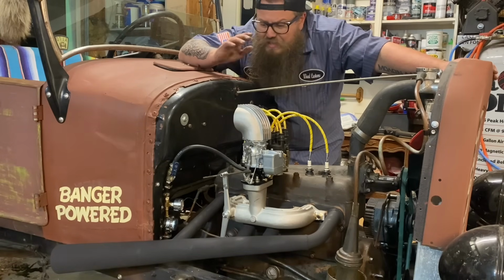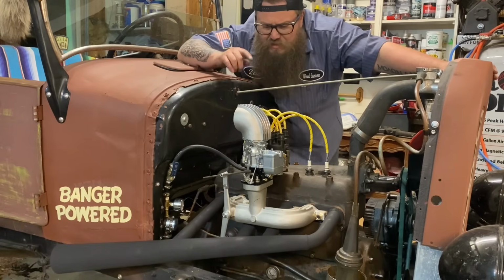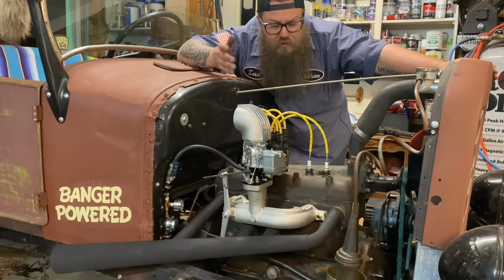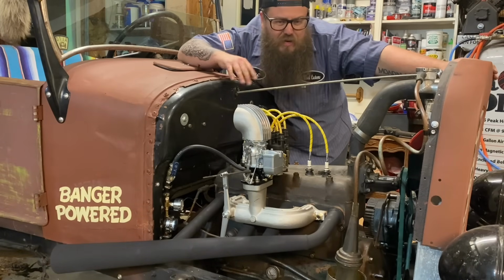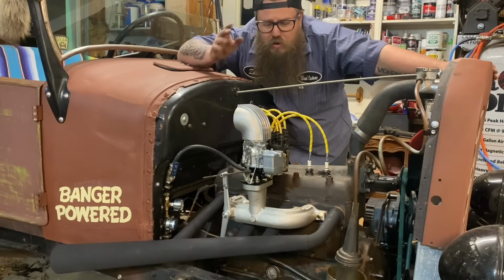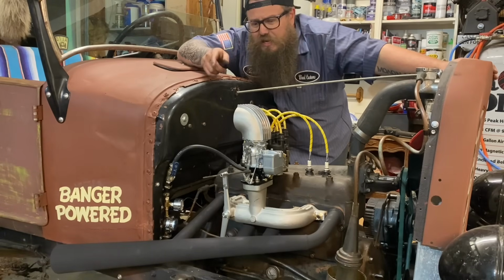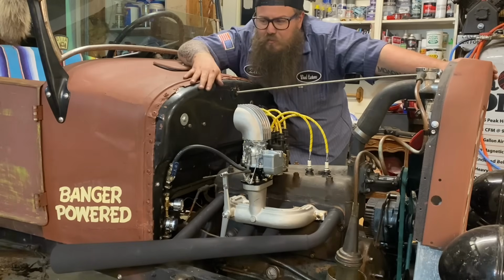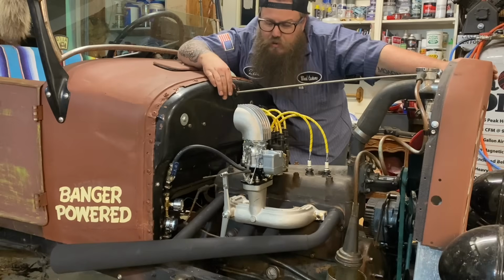It definitely has a lot of pep back in its step. This definitely increased the horsepower for it. No doubt, the Model A distributor and the stock Model A carb run good when you drive it like a tractor. But if you like a race car, something that self-advances, a carburetor that's a little bit more controlled definitely gives you a lot more control of the motor, air-fuel ratio, all that kind of good stuff.